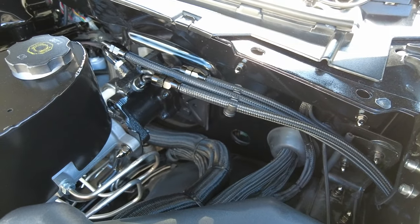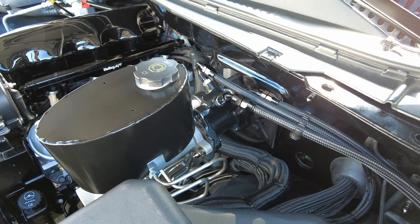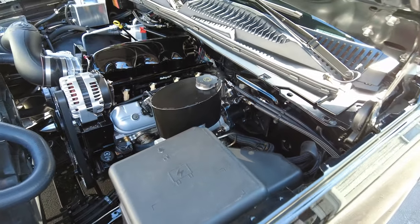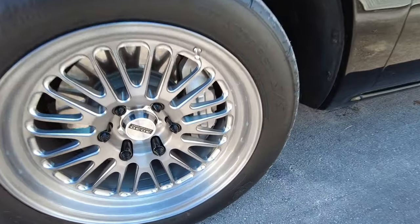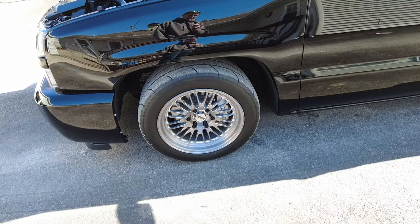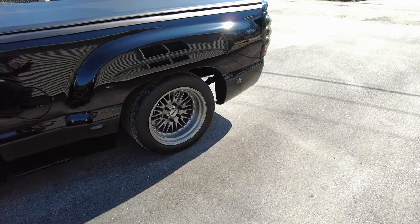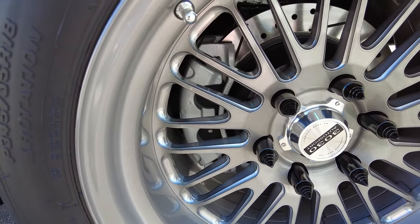We did swap to HydroBoost, and that thing helps drastically. We did all new stainless steel brake lines. For the brake system, since I haven't talked about that, we have the four piston 2020 calipers up front from the 2020 Silverados. I have a YouTube video for that. And we used some 2004 Yukon dual piston calipers for the rear. Those are not too bad.